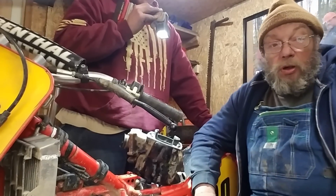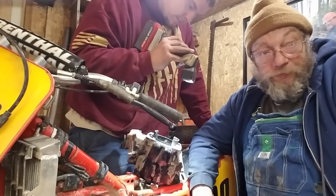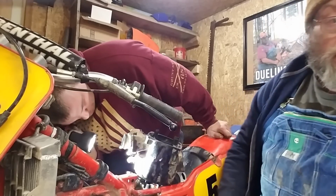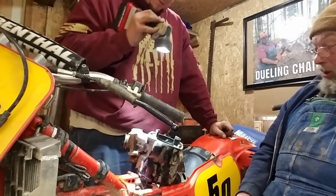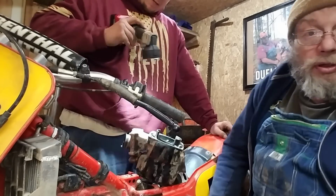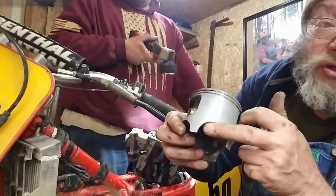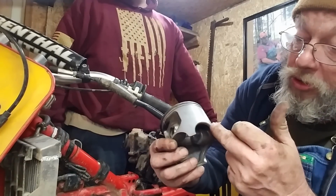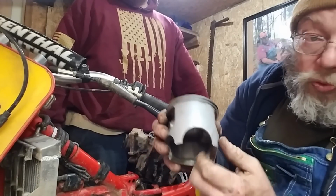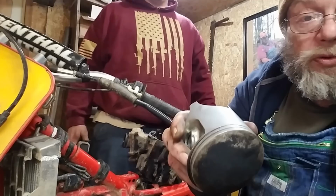Okay guys, we're going to wrap some of this up. We're going to show you a few things about bikes that transfers right straight away to chainsaws. Carbon fiber reeds in there. When you have the intake driven transfers, they're not case driven, it goes right in the intake, you'll see the knots on the inside. That can be altered and changed just a little if you need to. These bikes have some real issues because of the horsepower they get. They just produce massive horsepower, believe me.